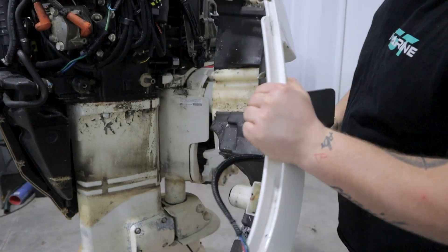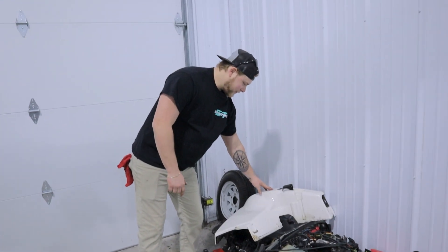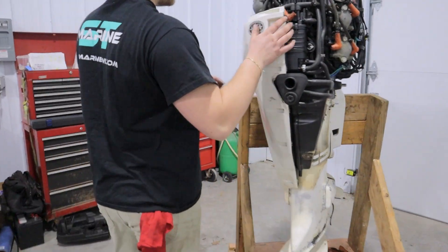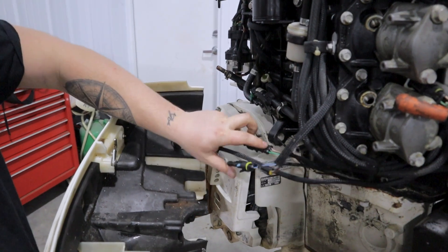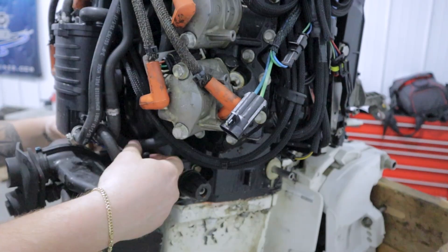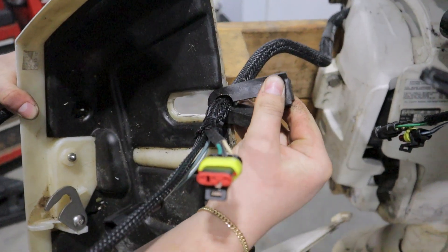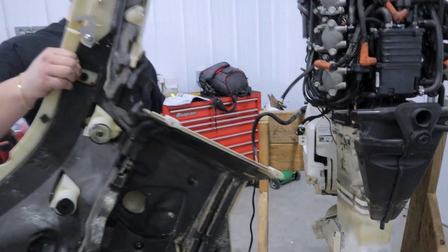Clean out all the metal from your blown-up power head. Coming over to the port side, give it a good yank. On this side you have all the wiring for your actual power trim — there's going to be switch power which pops off, then another connector, and the last one is your main power feed on this side. Same thing — lift up, pull the wire out. There's a grommet in here that splits in half — do not lose this because you'll have a gaping hole in the middle. Our wiring is free and our side panel is out.